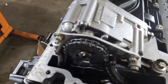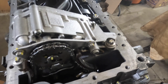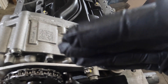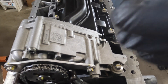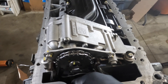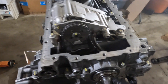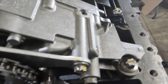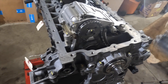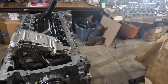Inspect your chain module, lubricate it — put some oil on the chain module. Rotate the engine a couple of times 360 degrees, inspect the path of the chain module, make sure everything is in alignment, nothing is skewed, nothing is loose. Check your bolt torque on the triangle chain module plate, look at your hub and make sure it's rotating through. Just a final look to make sure everything looks good and is tight.